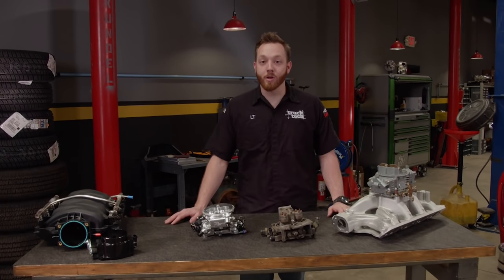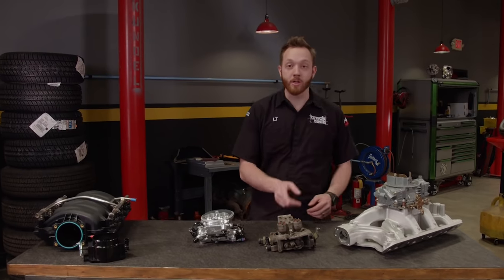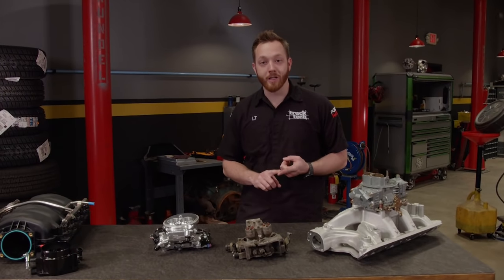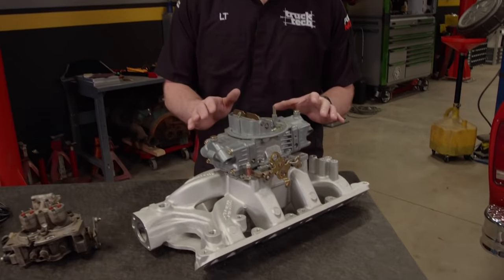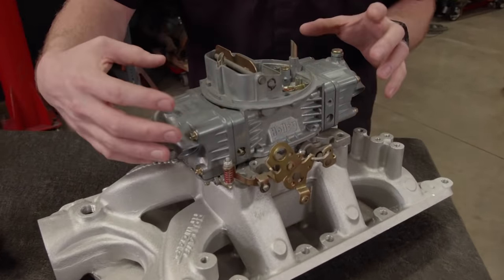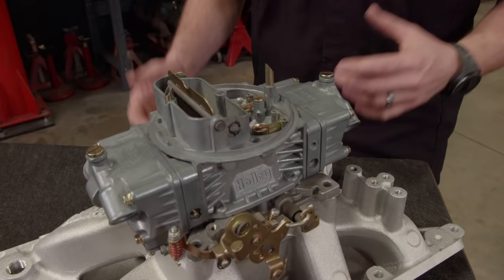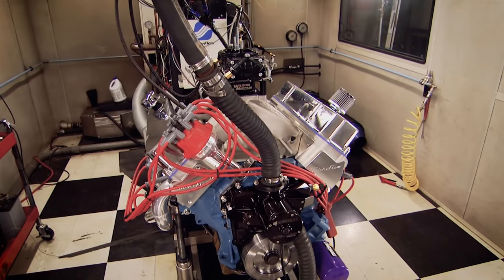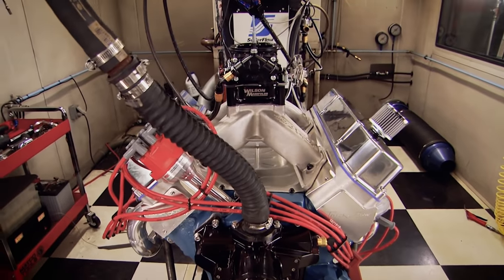The basic principles of an internal combustion engine are mixing air and fuel and burning it to create power. Through the years there have been many different changes in how that air and fuel are mixed and delivered, but the principles are all the same — control how much air enters the engine and mix the right amount of fuel with that air. Since the invention of the engine until roughly the mid-1980s, just about every vehicle on the road used a carburetor. Fuel gets pumped up from the tank and stored in little reservoirs or a fuel bowl, and it's delivered into the engine through small tubes using the Venturi effect — basically, the faster the air moves by it, the more fuel gets sucked along with it. Engine speed is controlled by how much air is allowed in, so as you press the accelerator, these plates or throttle blades open up. The air and fuel mixture is then distributed to all cylinders by the intake manifold.